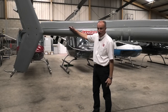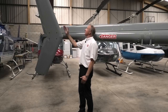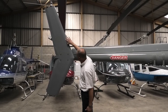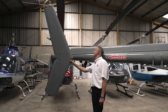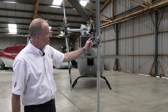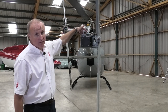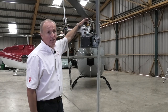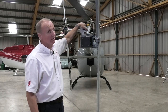We continue checking the tail rotor drive shaft cover, ensuring all fasteners are aligned in the same direction. Moving down the tail boom to the leading edge of the fin — it's a large surface area, so a good check on the leading edge and side skin for any damage. We check the four mounting points and witness marks on the side. At the rear of the 505, we check the trailing edge of the fin, moving downwards to the rear nav light. Moving to the tail rotor gearbox, we check the oil level, security of the chip plug, check the pitch change mechanism, and look for grease or oil that's moving around. The vent cap on the top: if there's too much oil in the tail rotor gearbox it will vent through this cap and you'll see a misting, which is a sign it's over-full.